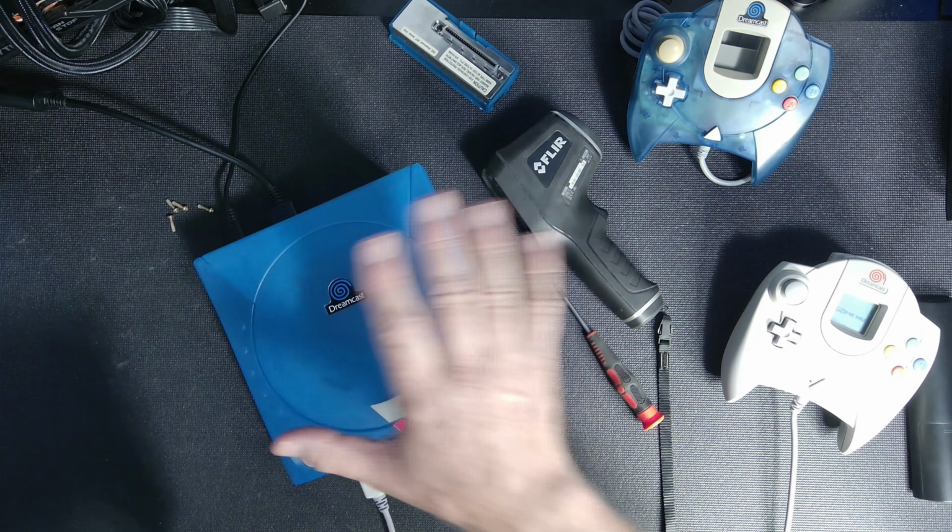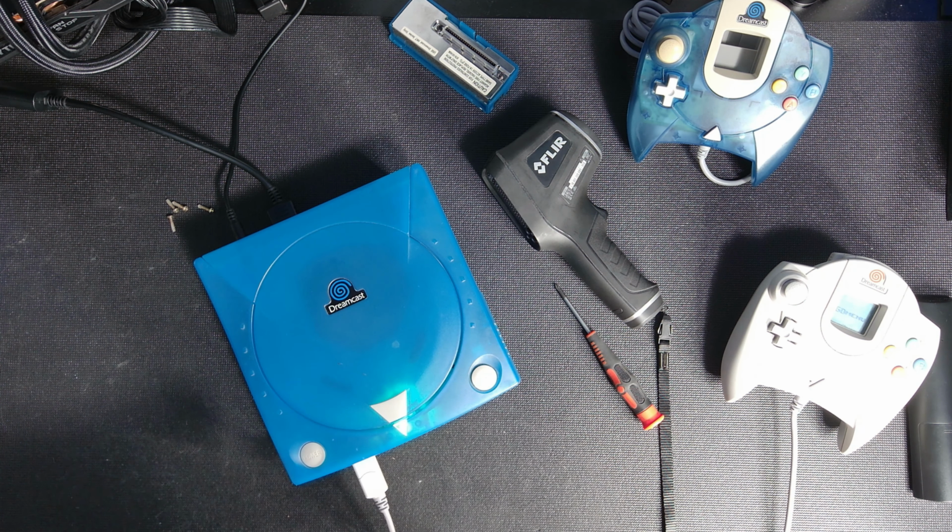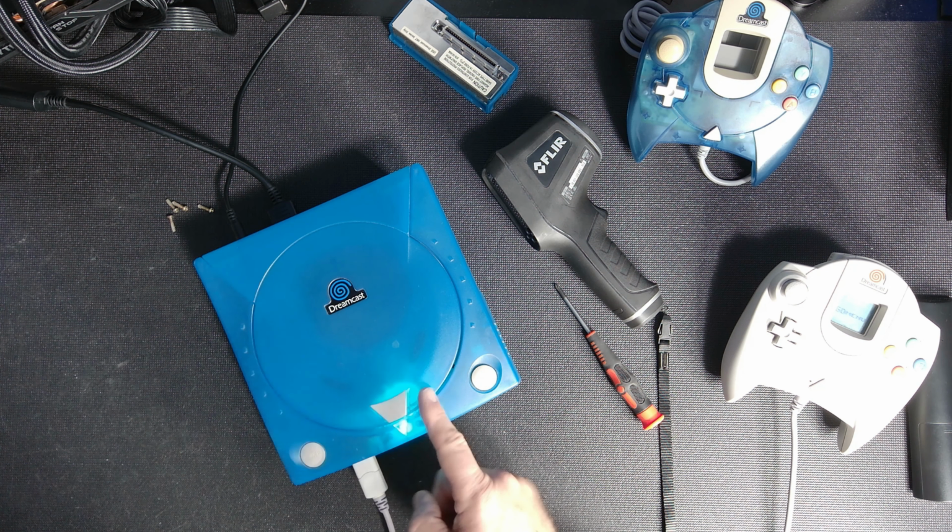And guys, intake is better than exhaust. It's exhausting out the back. It's taking in fresh air right here, moving the cold air across the product, not dragging cold air across and then becoming hotter than it's supposed to be, as it proves here with the numbers. So I hope this helps anybody cool their system down better, or maybe you're not having the issues, but I believe taking air in, going over your main component that's running the system, keeps it cooler by 8 degrees than having factory style out.